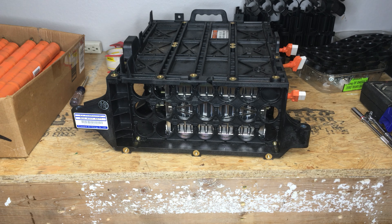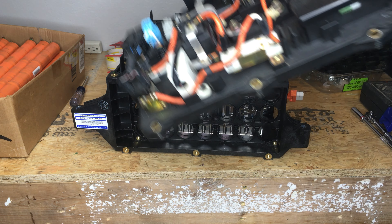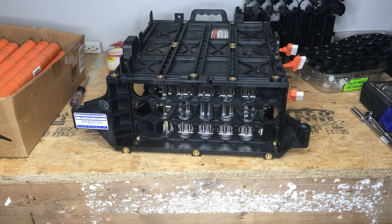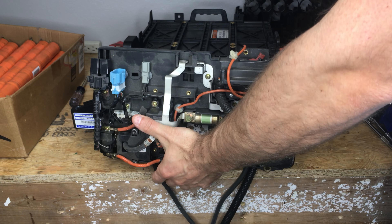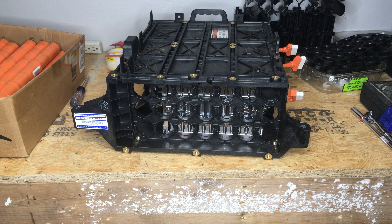We could probably reuse some of these stud holes, and from there you just throw the junction board back on the front. You will have to wire the power to it with cabling, but I've already done that before with other prototypes. The OEM junction board just sits right there and bolts into the OEM battery base. Since we don't have the OEM sticks, you basically replace those bus bars with wire, stick the wires through, and they'll hang out the side. The junction board goes right on top — that's a drop-in replacement, no modifications whatsoever.